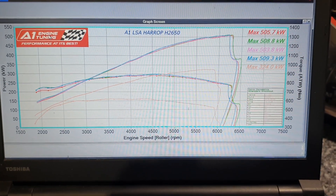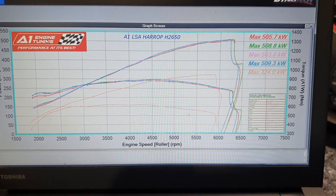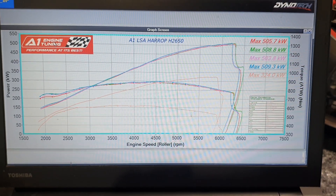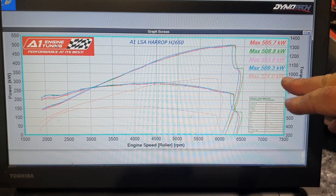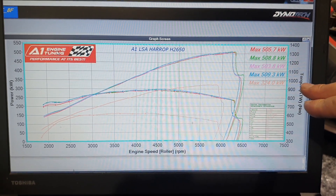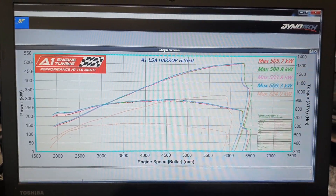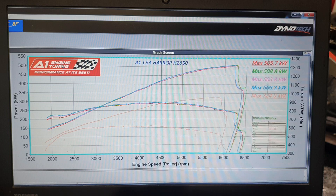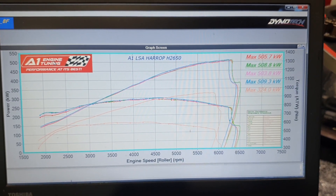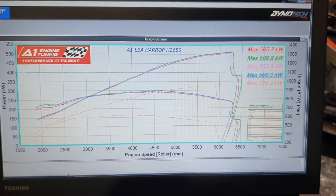Because this blower runs a fair bit cooler than the factory 1900 — simply because it's turning slower to make the same boost — it effectively has cooler air going into the engine. Down the bottom, this car is an automatic and originally made 324 kilowatts standard, so you can see the difference in torque and power is fairly substantial for really not a great deal of mods. We're still running standard heads, standard crank, standard rods, and standard pistons — pretty impressive, very happy.